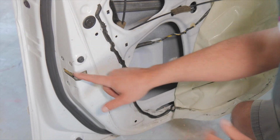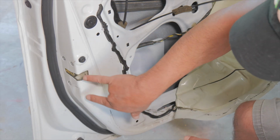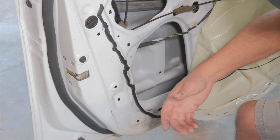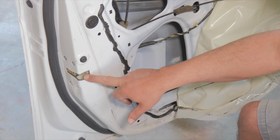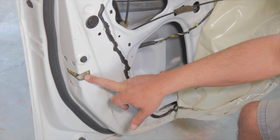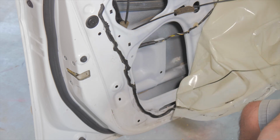Now, these 3 bolts are usually really tight. It takes a lot of support here. This is, again, what latches every time you shut your door. That's where it latches, so it has to be strong. And keep in mind another thing. A lot of times what causes parts like this to fail is if you pay attention to how everyone closes your door, especially kids, you'll see they slam the back door.